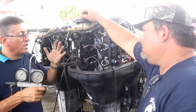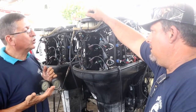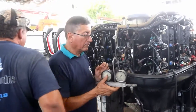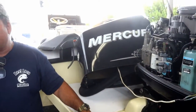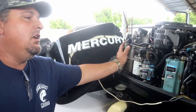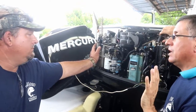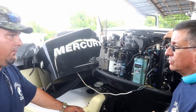In order to do a diagnosis of the system, you need the set of gauges. What other tool do you need to check the pressure on the system? That's really the only thing you need. Now, on this side, since we have the fuel pump available, you would put a fitting in line to make sure this is between 4 to 7 psi. If you don't get fuel from the lift pump side, you don't have enough fuel pressure, not enough fuel for the high pressure side. Is it possible to remove the output hose of the high pressure pump to verify the pump is pumping? Yes, you could actually do that from right here. It's not dangerous? Well, it's got 42 psi, so you have to be careful.